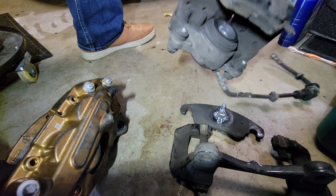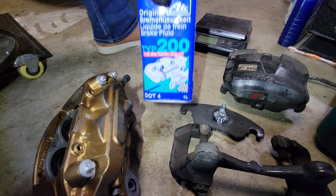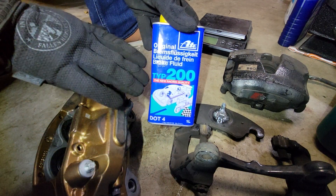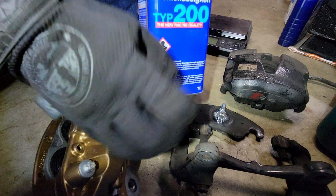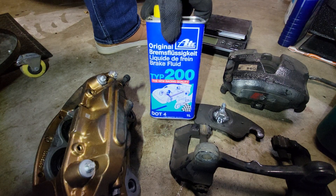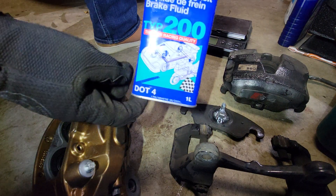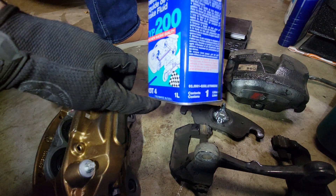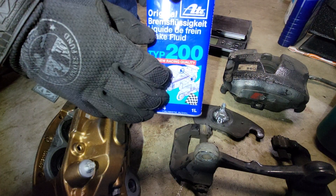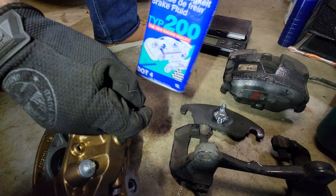The other thing you're going to want is good brake fluid. Any brand will work, but the big thing is to look for DOT 4 and high quality. The best brake fluids come in metal cans — they have more volatile chemicals in them, and plastic-can ones are not as good even if rated DOT 4. ATE makes a really good Type 200 racing fluid, which is what we use. You want DOT 4, a name brand, racing fluid is great, and make sure it comes in a metal can. Check the MSDS if you are unsure.